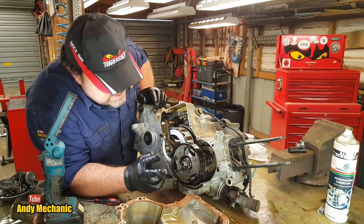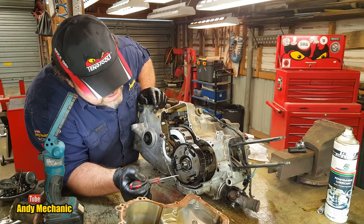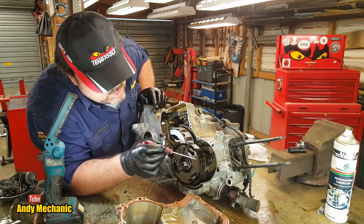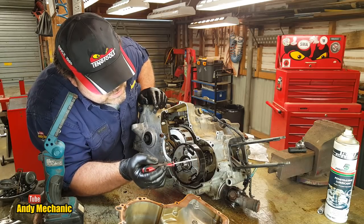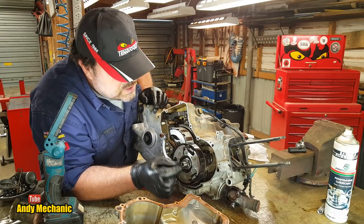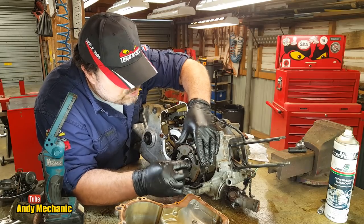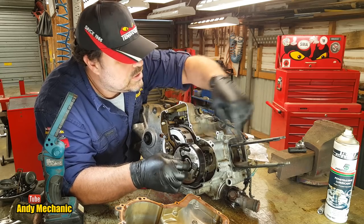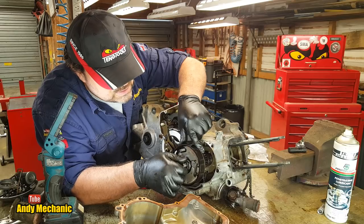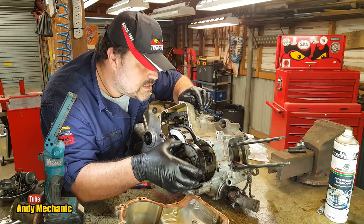Well, we've got a centrifugal clutch just here, and that's got the three shoes. They're very heavily weighted shoes, and they get thrown out against these springs, against the spring force, and they make contact with the drum. So it looks like the shoes are driven directly off the crank. If I hold the drum and turn the shoes, you'll see the conrod popping in and out just down there, look. So the shoes are directly driven by the crankshaft, and then the drum has a sleeve.